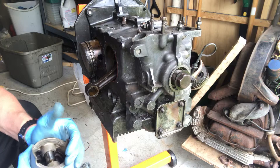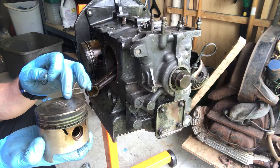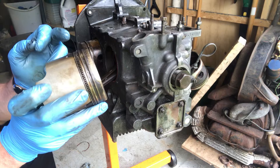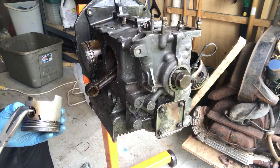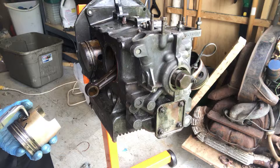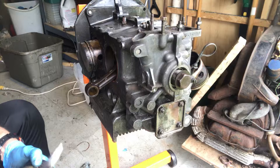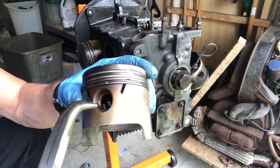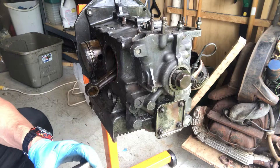I just pushed this back in by hand. What I like to do is put all of these parts back together in the same fashion that I took them out. This is piston number four — I'm going to make sure I keep this piston with jug number four. As I explained on previous videos, these parts over time wear out, and if you don't keep the parts together and swap them for each other, you end up getting bad compression, oil leaks, and so on. I'm placing that spring back in there — see that little loop, that's where you grab it when you're taking it out. You just grab it right there and pull it out like so.